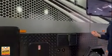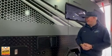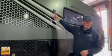Now here you've got your fridge ventilation. You're ventilated from the roof all the way down through here. It's very important with your fridge, please don't block off these vents. Some people do. The fridge requires that downdraft of air to work, and if you block off the vents and restrict circulation of air, it can actually cook your fridge in really hot conditions. So please avoid doing that. Now this vent up here is your exhaust for your fridge when it runs on gas.